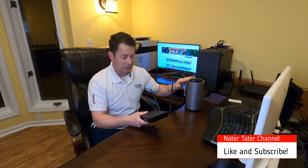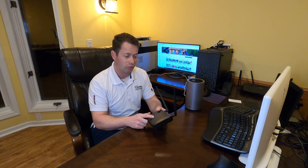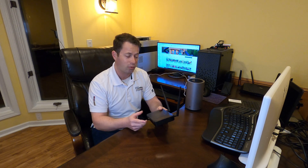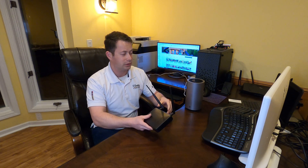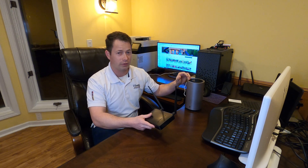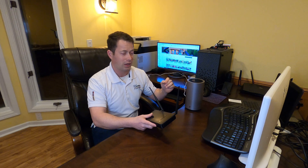You can turn off Wi-Fi on the gateway. One thing you could do is put your own router into AP mode or access point mode, which would turn off DHCP on your router — meaning the gateway would do all the IP assigning and routing. The problem is I don't like the way this handles it, so I don't recommend that. But that is one way to get away from adding another layer of NAT.